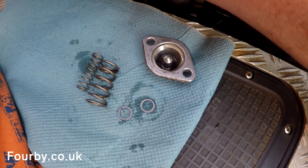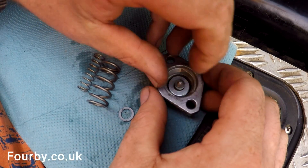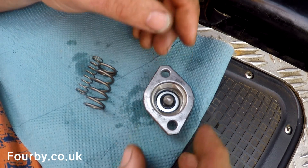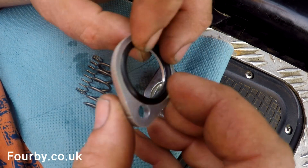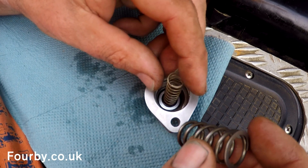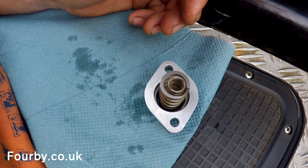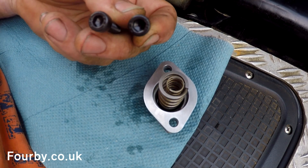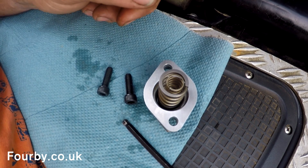We're going to put some shims in from the boost ring pack. I'm going to put three shims in on this engine — I'd recommend going with three first. Put those in, then put the old shims back on top. The boost ring goes on there, then the center spring goes back in, the main spring goes back in. The kit comes with a couple of slightly longer bolts with hex heads, which gives us the advantage of using the ball-end Allen key to fit them back in.